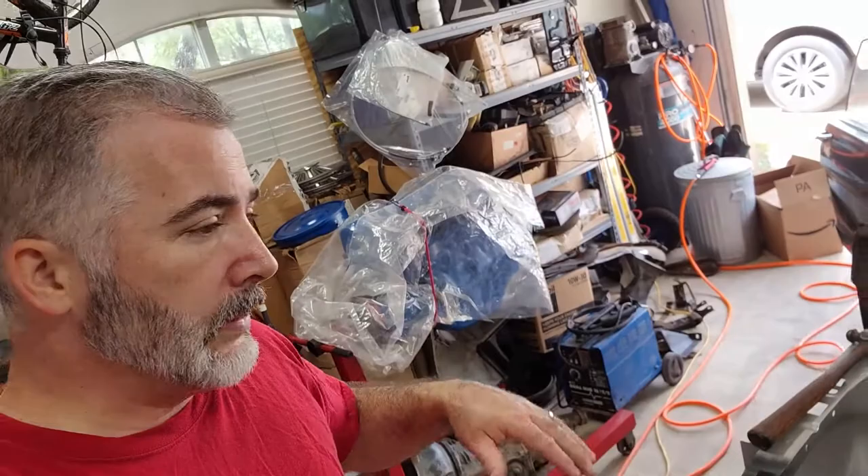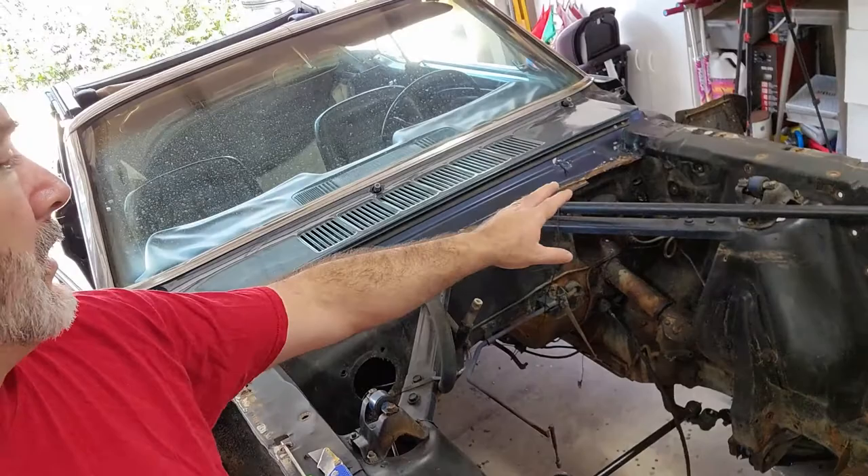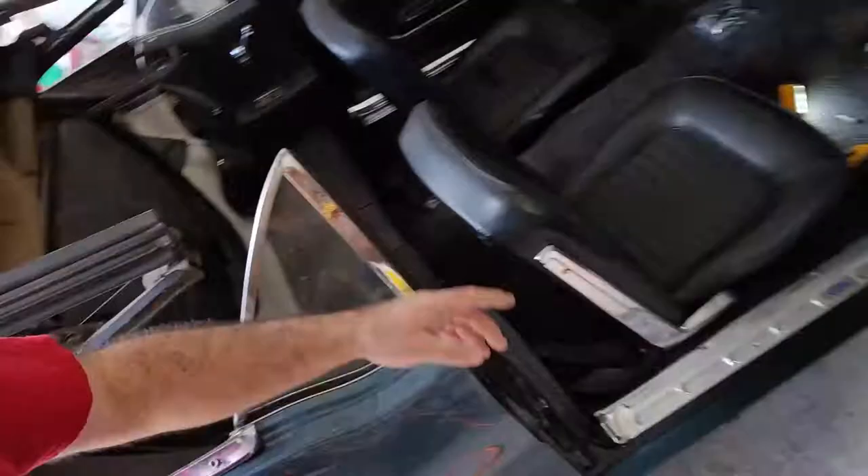Really, the issues are against the firewall. There's a lot of crud buildup, like on the steering box and up against and underneath the brake master cylinder and all that. And then right around here around the fan motor and squirrel cage. So first steps is to get the heater box out — I've already started it — so I'm going to finish doing that. That way I can see not only the condition of the heater box, but get these heater hoses out of the way and get the fan motor. I've already pulled it out enough. That way I can get the firewall nice and cleaned up before I actually paint.